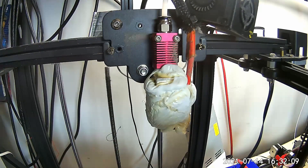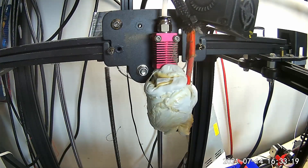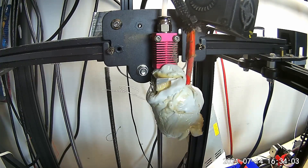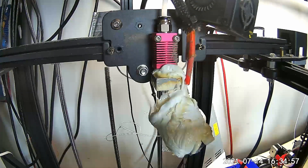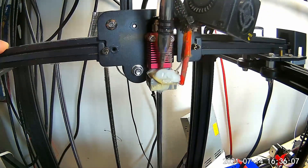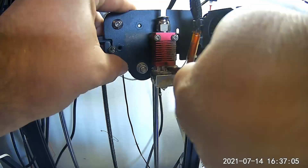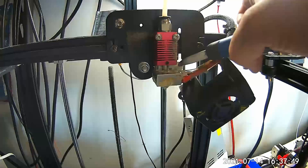At this stage, you want to get in there with some kind of small cleaning tool, preferably something that is not metal, because we don't want to short out the heat cartridge or the thermistor. We just want to clean up as much as we can. Sometimes these materials will turn to liquid and melt away, but other times — in this case, because somebody here forgot we were working with ABS filament — it tends to stick to itself and doesn't move nicely, so it sometimes needs that little extra assistance to clear it off the block.